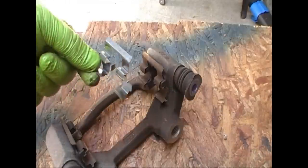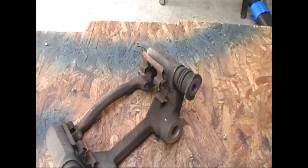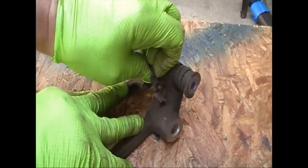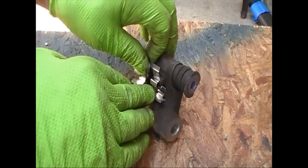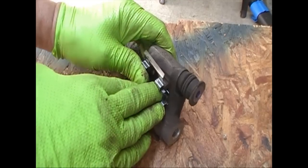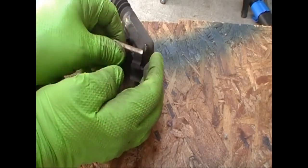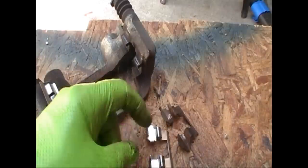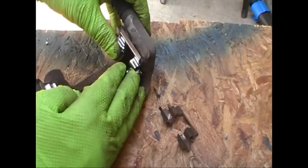Here's your carrier slash bracket — there are shims that come with your new brakes. You just want to orient them right, pop the old one out, and put the new one in. Pull the old rusty-looking one out; they're made of stainless steel but they get a lot of junk on them. The new one is going to snap into place — don't bend the little ears on the end while you're doing it. Flip it around and do the other side as well. The new shims will have the brake pads sliding easily and not getting bound up, and eventually they'll wear out anyway.